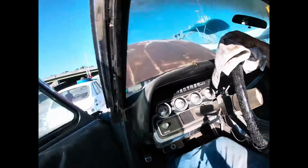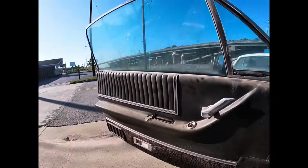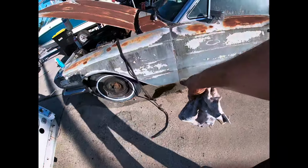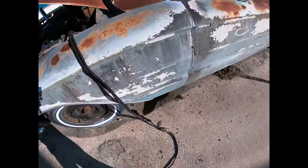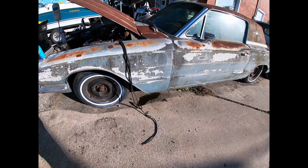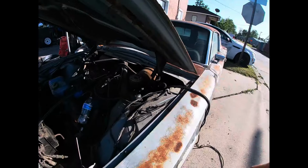So I'll pump on these brakes a little bit and start looking for leaks, because I'm sure we ruptured a brake line somewhere, even though that was new. Yep, there's the brake line. Guarantee that's brake fluid. Yep, brake fluid. All right, that's the next project. We'll do that tomorrow, get it jacked up and find out what is broken there. So cool.